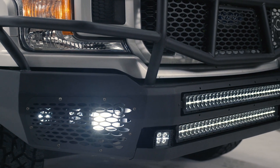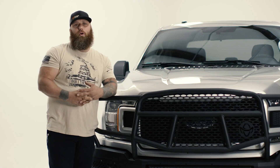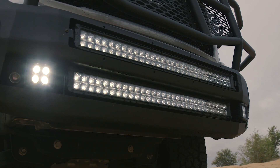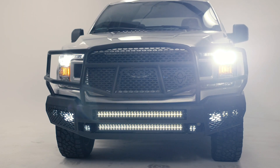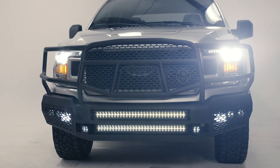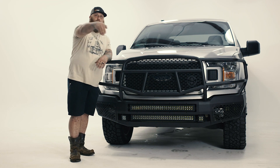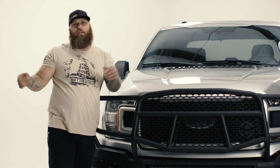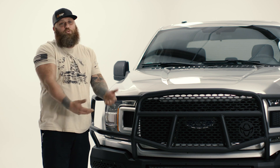The DRLs are good for early morning fog and they're street legal, whereas the light bars are off-road lights. The reason I didn't go with a full-length bar on the bottom and instead went with two cubes on the ends is to give it a radius — so your light comes in a radius with the bumper. If you just put one light bar in there you're going to have a void space. This gives you crystal-clear lighting with no gaps. There's nowhere I've mounted that I didn't drill the holes myself — it's all custom.